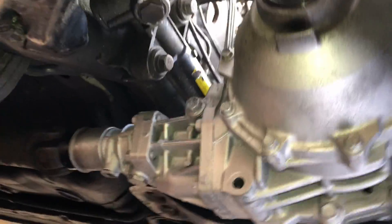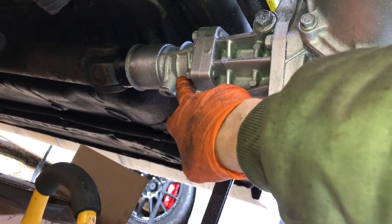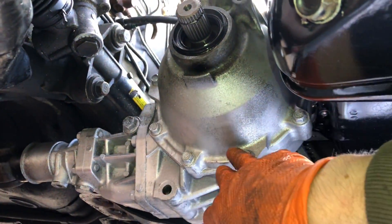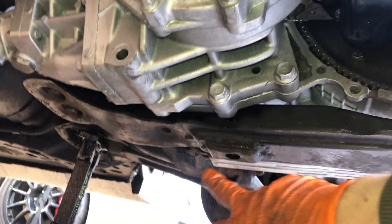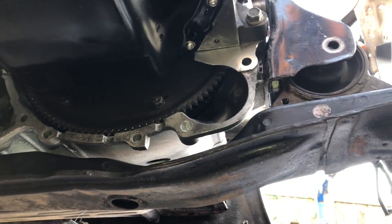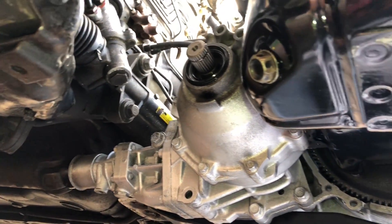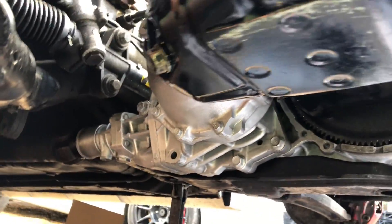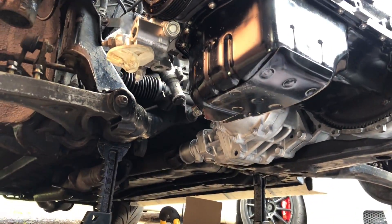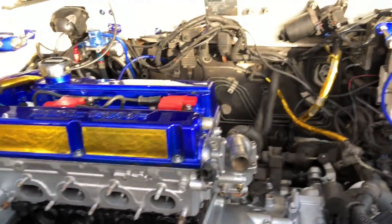Right, so I'm underneath here and I've got the transfer case up. It's not that difficult to get on - I've got one more bolt to go in. What I normally do is lift the drive shaft up, slot the drive shaft in first, then lift the transfer case up, get a couple of bolts in with a jack. I've also just got the cross member in. The gearbox mount bolts aren't fully in yet because I've just got to move the gearbox backwards and forwards to align it, so I've left it all loose. I'm going to get that all bolted up, get the drive shafts in, and that'll be it for this episode. It's looking nice and clean even underneath - this ain't a show car, it's built for power. Evos are built for racing.